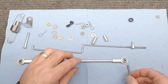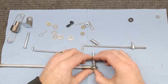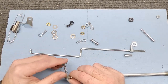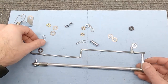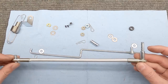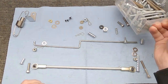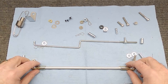For these end connections, I'm using a shorter piece through the back side of the end link, with a washer to keep it from pushing the bushing out of the throttle lever, and a cotter pin. However, when testing this out, I didn't like that with the cotter pins in there the system could still wiggle a little bit because the connections weren't perfectly tight. So I'm going to swap these out for proper fasteners — a bolt and nut on each end — tightened down. That will be a much better option than the cotter pin setup.